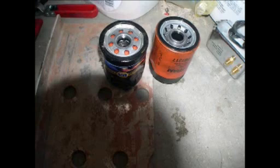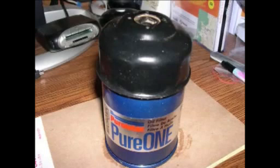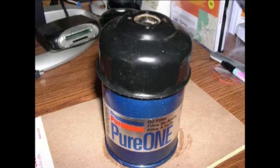And then while you're there, buy one of these metal caps. Filter wrench. I think it's 63 millimeter. Don't hold me to that, but I think that's what it was. But it'll fit right over the end of the filter. And then when you get ready to put the filter on, leave that cap on it. It's not going to go anywhere.